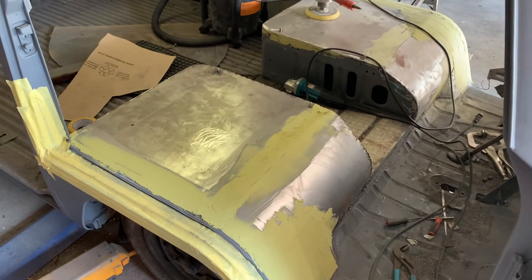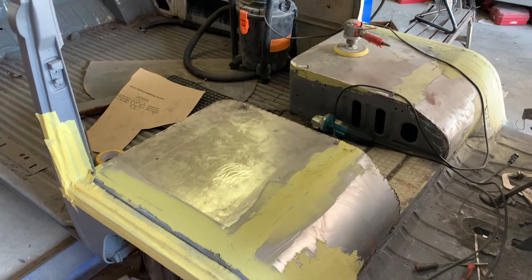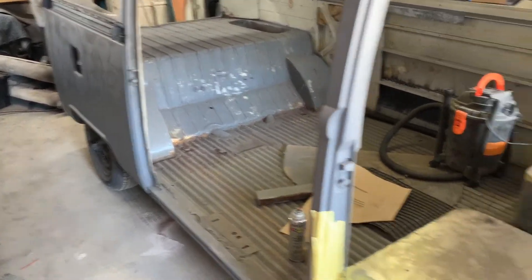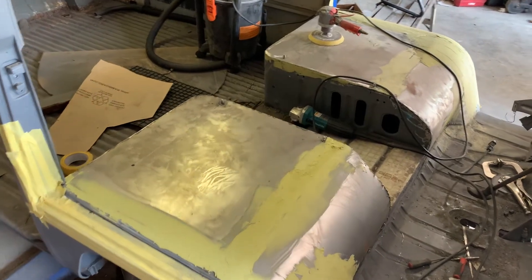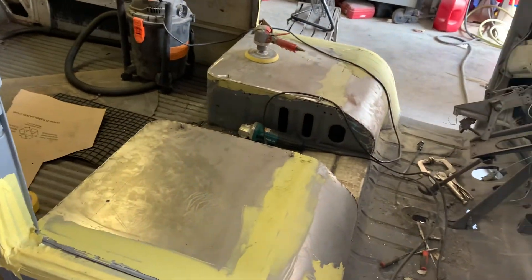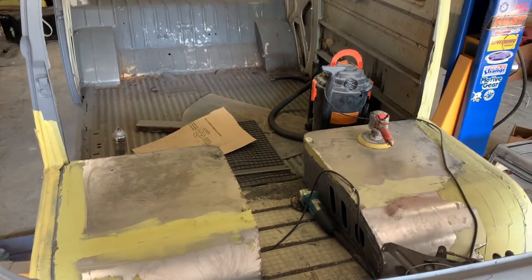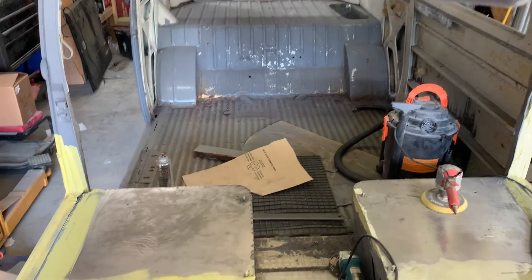One of the last major fabrication things I was tackling was what they did to the seats — they put a bench across it, probably for wheel clearance, which we're going to have to adjust suspension height on anyway since the rear tires don't come off because of the built-in side skirt. I ended up reinforcing this whole thing with three-inch by quarter-inch steel and stuck my studs up through. The owner is about 6'2" so it's nice being able to fit the seat properly. It has slider rails and the seat backs fold almost flat.